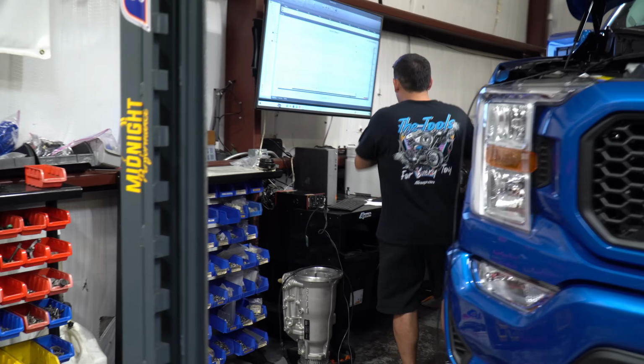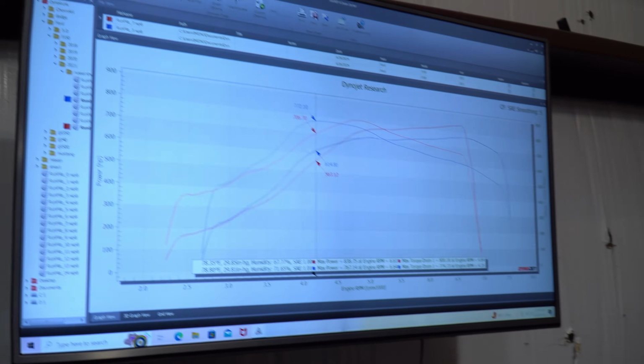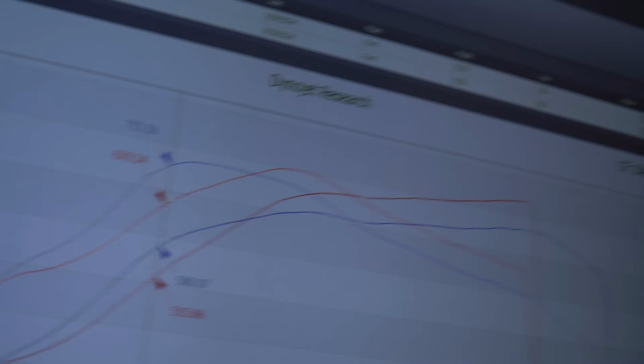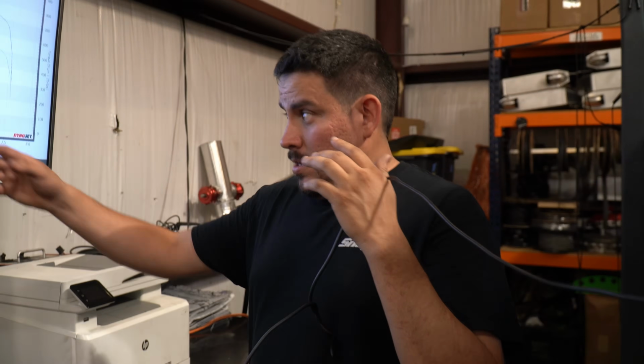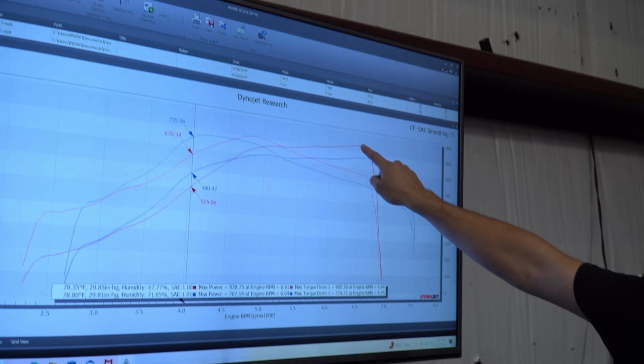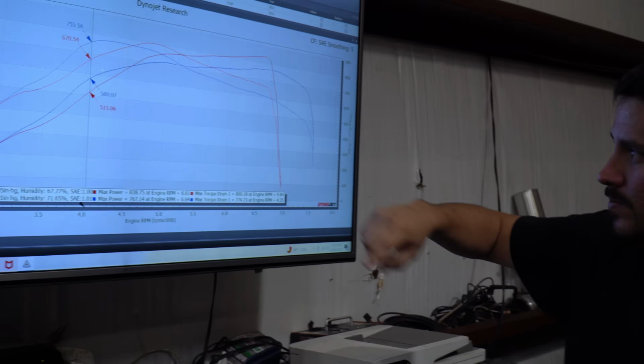So if you look at the little turbos, if you plan on sticking with 93, I would do the little turbos, which top out at 14 to 15 pounds. At 14, 15 pounds the little turbos will probably make the exact same thing. They might not, because this one was going to keep pulling. The little turbos kind of die off.